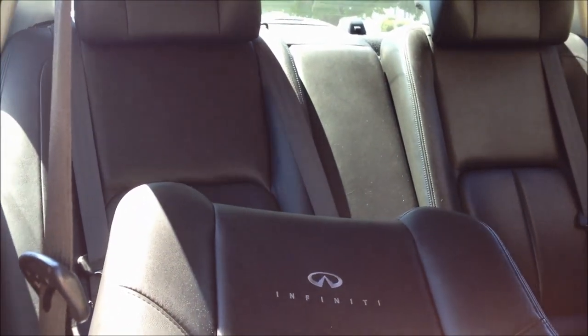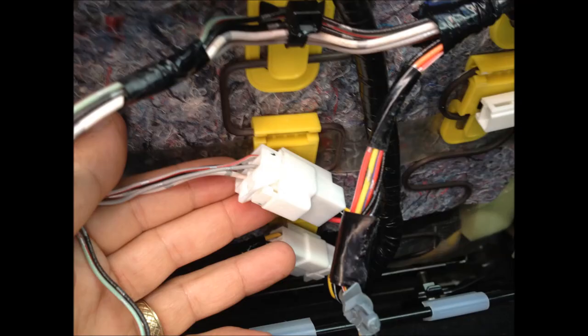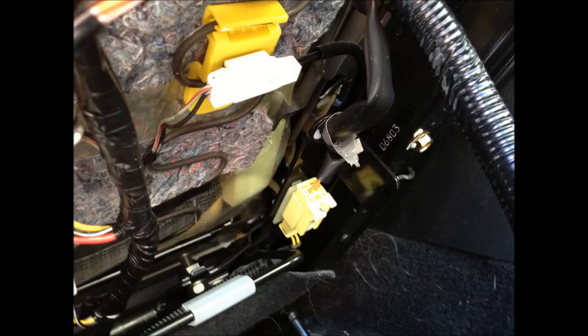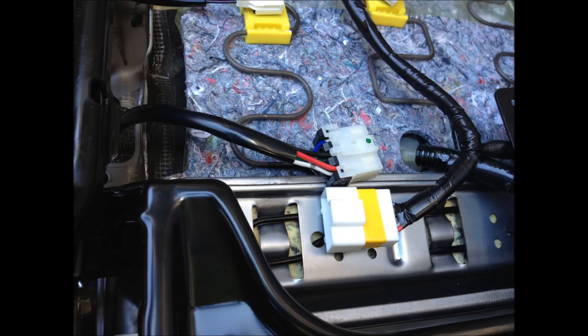I put the seat back in position and I'm ready to connect all the wires. This time I took the top of the seat off just to make it easier to get it inside the car — you probably want to take it off before you pull it out. Next it's time to reconnect all the connectors. There was one with little pins that hold a connector to a plate under the seat — I had popped those out but simply reinserted them back in. They had a recall on this car because these wires were getting pinched, so make sure none of these wires can get caught up and ripped. Make sure you plug the cable to the switch assembly back into the mating connector or it won't work.